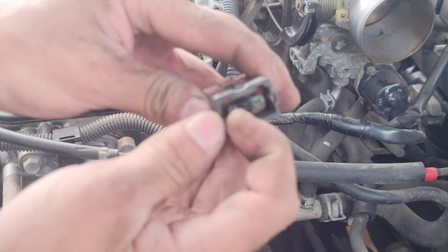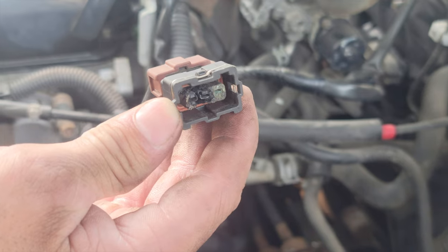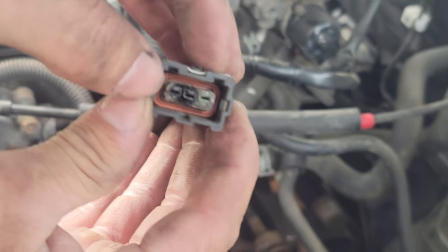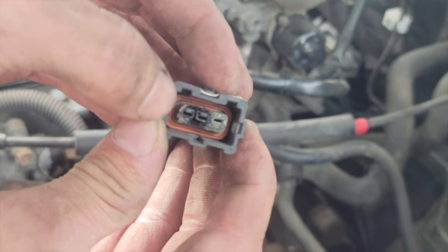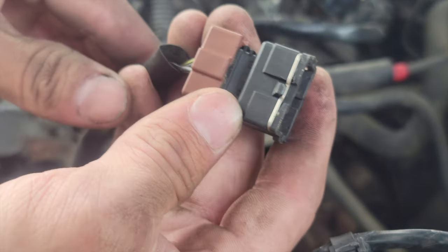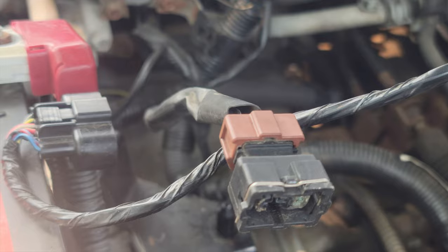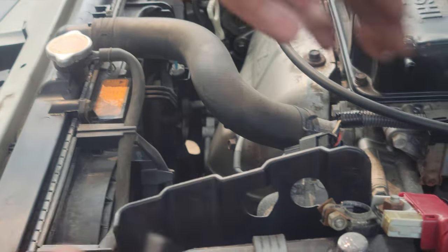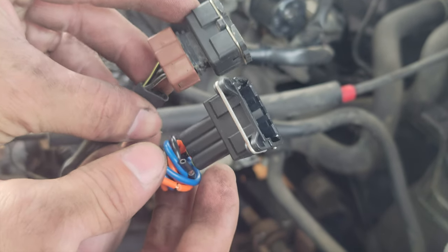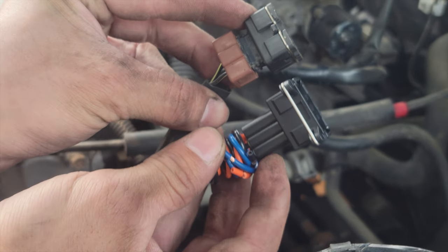See how it's burnt there? That's how I know it's the speed sensor. See how much better when it's focused — see that's where it's burnt right there. That's why my speedometer and odometer don't work. So now we're going to replace this. How you replace it is you line it up the same way for each wiring and you splice on a butt connector, and we'll show you.